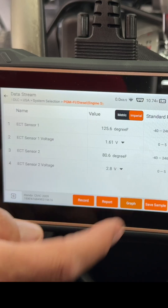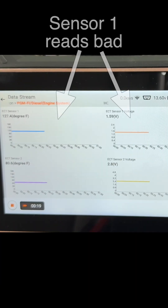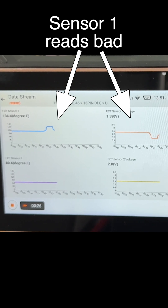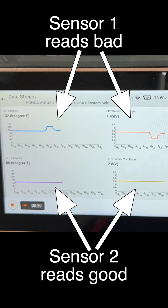I'm going to focus on the 662, and I'm going to show you how I graph my coolant temperature sensors to find the problem. Look at the coolant temperature sensors — you see how they bump up and bump down? That's how you can tell you've got a bad coolant temperature sensor, and that's why you need a good scan tool.